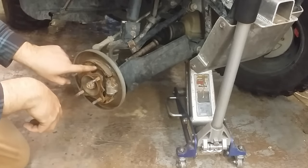Bonus — not many people know how to adjust the brakes on the rear. Most of the time they don't work and people just assume they're bad. You can see back here these two little thingies — you turn these to tighten it up and pull the slack out of the cable. Once these are bottomed out where there's no spring left on the cable, that tells you the brake pad is worn out. Pop the wheel off and it's almost the same as the front — you just pull the springs off.